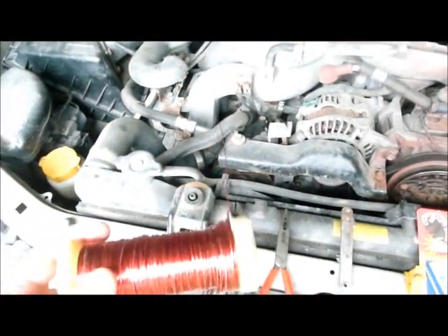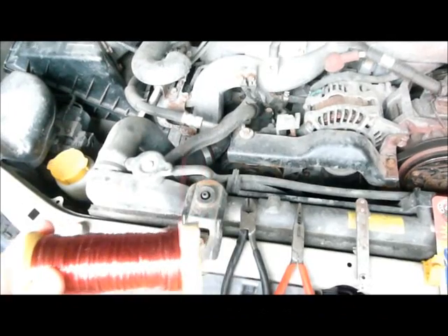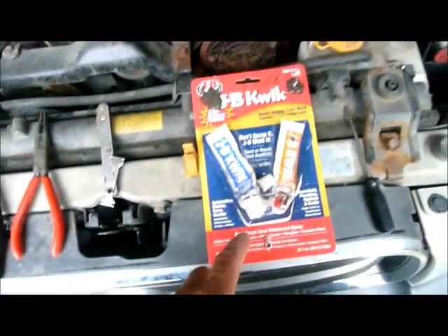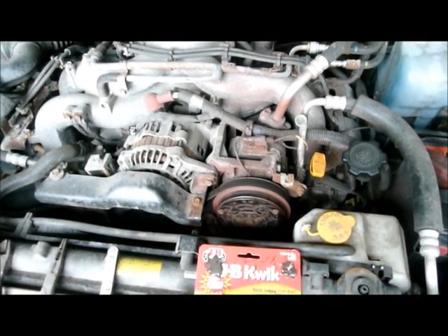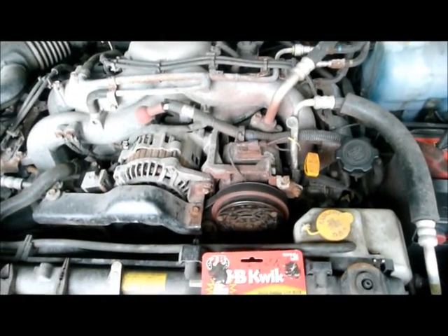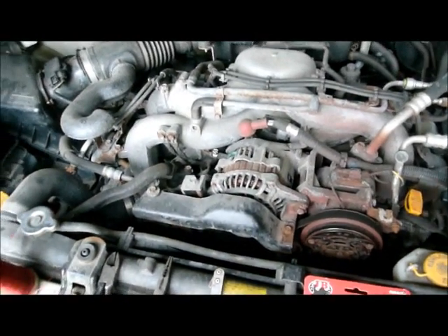Here's what you'll need. First of all, you're going to need some thin wire — I used magnet wire, 23 gauge, which measures about 20 thousandths of an inch in diameter. You're also going to need a pair of wire nippers, a pair of needle nose pliers, a set of feeler gauges, and some JB Quick epoxy. This is just what I did — if you come up with a better solution, please put it out on YouTube. So far this seems to be working fine with no problems with the cycling of the compressor. You'll need about three feet of wire, just so it's a little easier to work with.